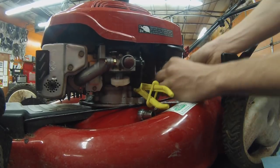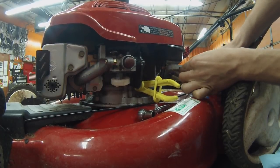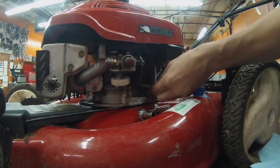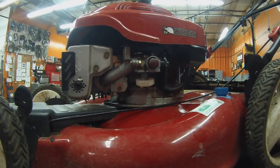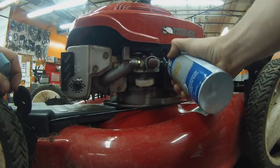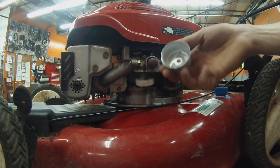Now that the fuel tank is fully drained, we'll go ahead and reassemble everything. When your carburetor looks okay like this one, you want to spray a little carb cleaner up inside it and also in your intake — that'll knock some of the debris off. This one's not very dirty so it doesn't need to be removed. Same goes for your carburetor bowl — this is what holds your fuel, so all the deposits are going to sit in there and you really want to get that clean.